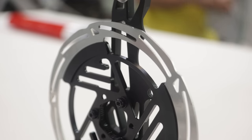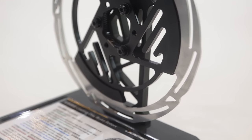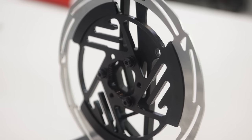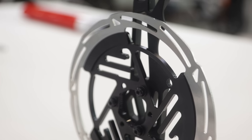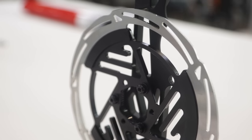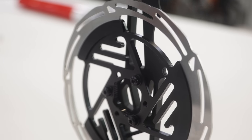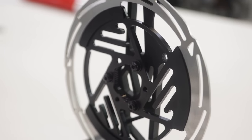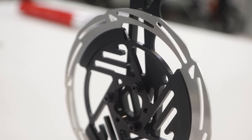Also interesting: an aluminium spider with a stainless steel braking surface, friction welded with a large surface area and no rivets. In theory, the heat from the braking surface transfers into the aluminium spider more easily, and that aluminium spider has a huge surface area which should enable much better cooling. We'll see what peak torque makes of this one.